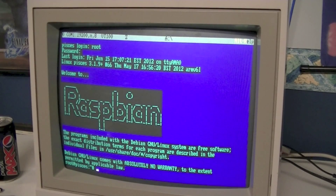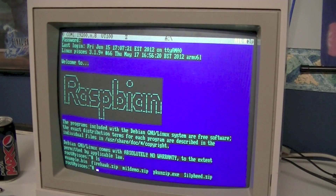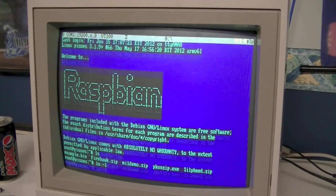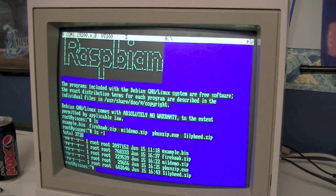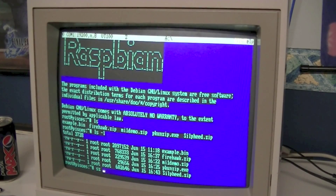Since this is a Linux machine, I could go anywhere on my network. I could connect to a network share on one of my Windows PCs, or I could connect to a website and download a file. Here's one I prepared earlier — let's use Silpheed as an example. Now that's 682K, so it'll take about five minutes to transfer. I'll use a command on Linux called SZ, which basically outputs Zmodem protocol to the terminal, to the console.